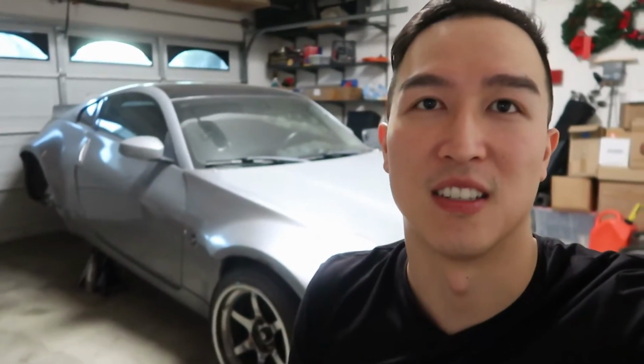So I ordered rear camber arms and rear traction rods, and so now I can have full adjustability, bring the camber back out. Right now the wheels are like this, and it sticks out on both sides of the car. Only part of the wheel was getting traction. And I'll show you guys actually.